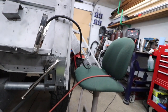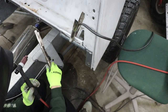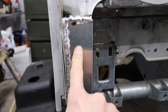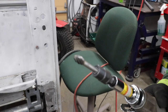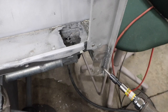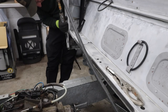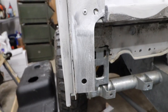Now we got this side all fitted up and clamped into place — we'll buzz it in. We got both sides welded in, we'll come in and clean them up, and we also need to punch the upper hole. We're going to take this little burr which has a nice rounded end and radius that edge there — that should work out nicely. Still got a hole there.